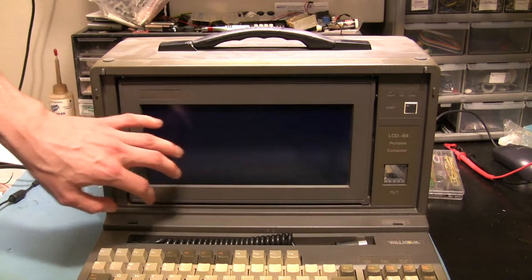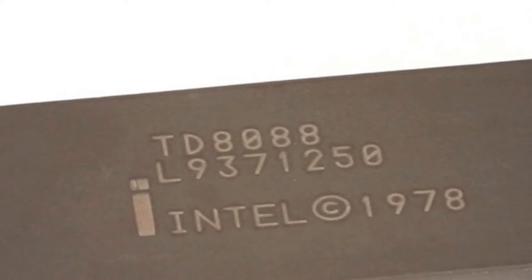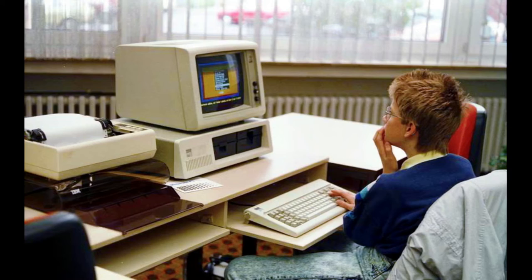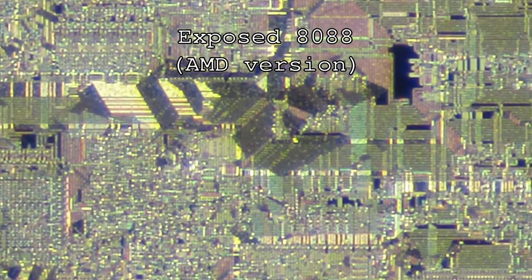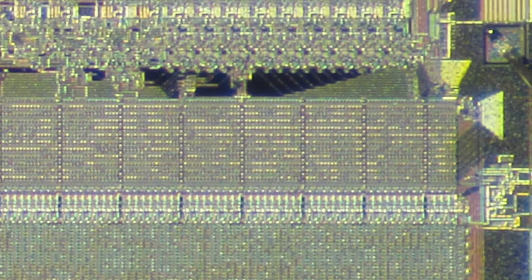If this machine really does use an 8088, that makes it pretty interesting, because that chip was the same chip used in the original IBM PC, the 5150, introduced in 1981. You might be familiar with the Intel 386 or 486, even the 586 — and you might wonder, shouldn't it be the 8086? Well, the 8088 was actually a cost-reduced version of the 8086. It was software compatible, but it only had 8 data lines instead of the 16 of the 8086, making it cheaper.